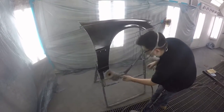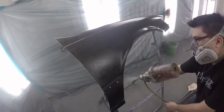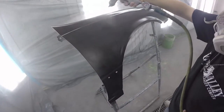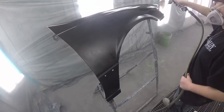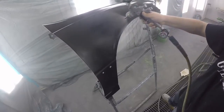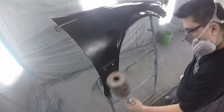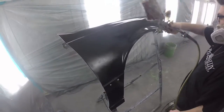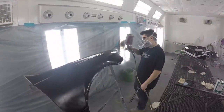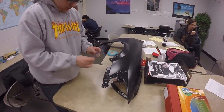50% overlap is standard, but the one paint where you actually need 75% overlap is candy paint. Candy paint is a transparent paint commonly seen on lowriders and some Cadillacs — you can see right through it. You put a silver base coat under candy and then spray it on top. It's a very difficult color to spray because so many mistakes can be made by just one swipe of paint. Robotic attitude — just try to cover the best you can.